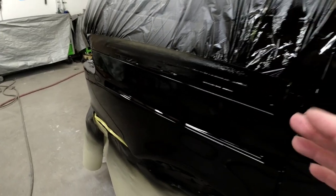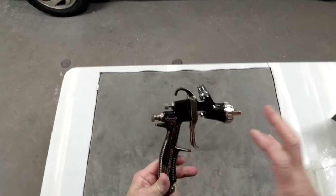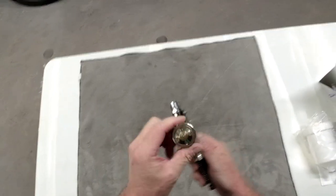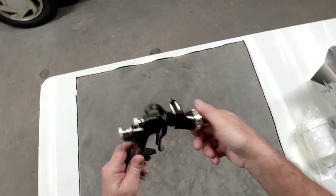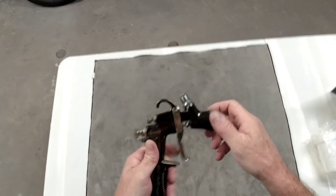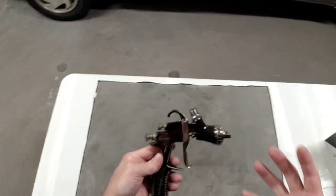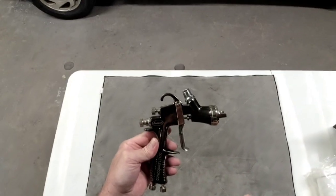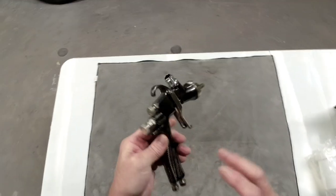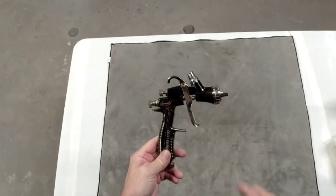Today I review a budget paint gun that's going to give you amazing results with a small compressor. This is the Eastwood LT100 — I reviewed this gun a few weeks ago, took it for a spin, and it performed beautifully. The great thing about this gun is it has a low CFM, requiring very little air to run properly. It has 4.25 CFMs, where conventional guns take at least 13 CFMs to run consistently. This is a very good option for a DIY repair or someone working out of a small garage at home.